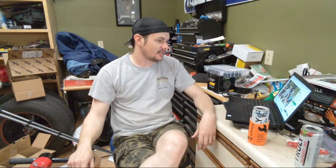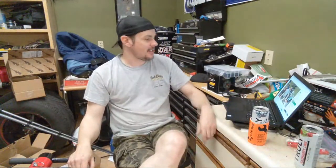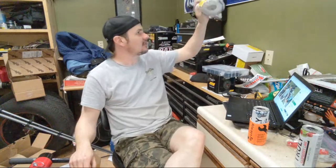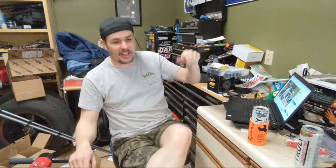Oh, I don't know. I haven't done it yet, Chevy for Life. I'm going to do it probably tomorrow. Listen, I pulled the transmission out yesterday. I almost vomited twice because of my equilibrium being so far off. So I'm not getting down on the ground today if I don't have to. So I got to pull the rear main seal, install the new one, and then I've got a TCI torque plate or flex plate to install.